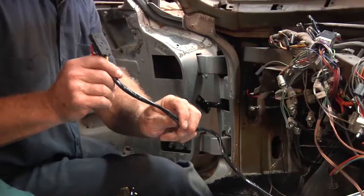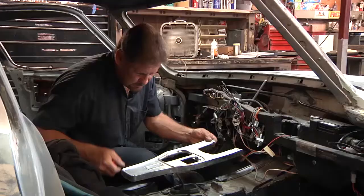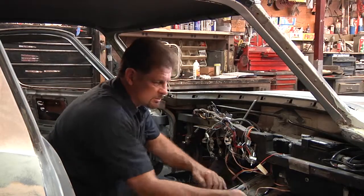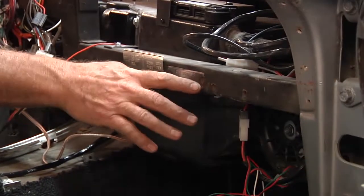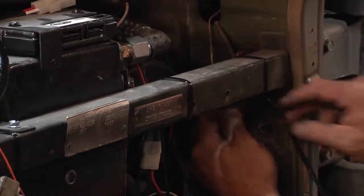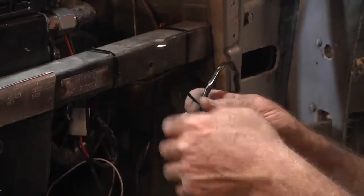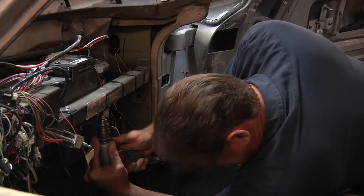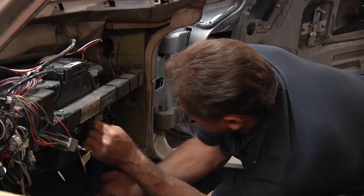One part of the harness — your switch control — is going to be coming right down the center of the car and going underneath this plate. Remove all the Phillips screws and lift it up. The green, yellow wire and ground wire are going to continue going underneath this support bar. Zip tie along the last rail here, coming into the hole and running into the door. A couple feet from the end of the wire plugging into the right-hand power window motor, they give you a ground wire. Drill a hole into this cross support, rough up the metal a little bit for bare metal contact, then get a self-tapper screw and ground it right here to this crossbar. Continue everything else going inside the door.